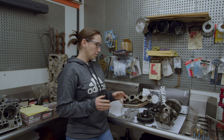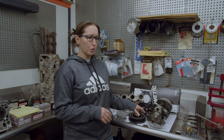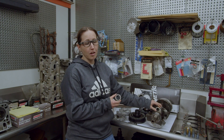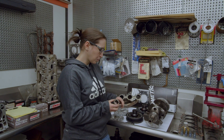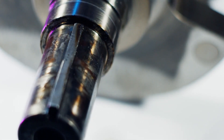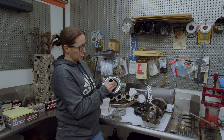One of the major issues I had: when you pull the engine down, look at the crank. Coyotes are known to have crank issues when making really big power, especially on a blower car. The crank bolt kept coming loose so I knew it was going to be ugly. This is a billet Bryant crank — a big upgrade I did over the summer after snapping cranks previously. Basically the vibrations caused the crank gear to weld to the crank. You can see heat marks, wear marks, and actual metal welding on the snout of the crank.